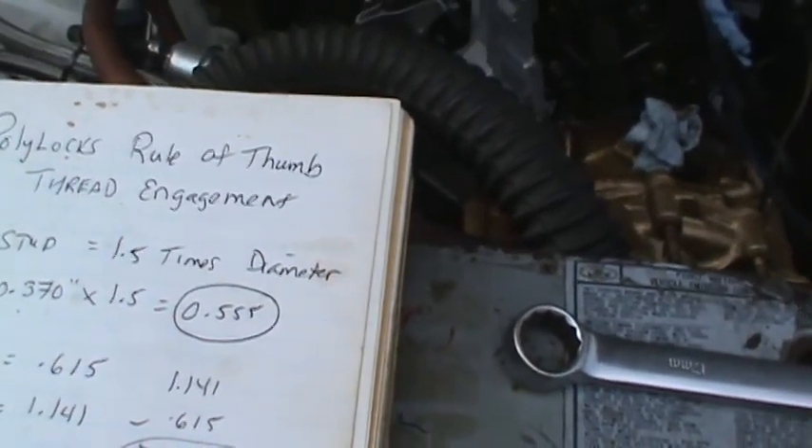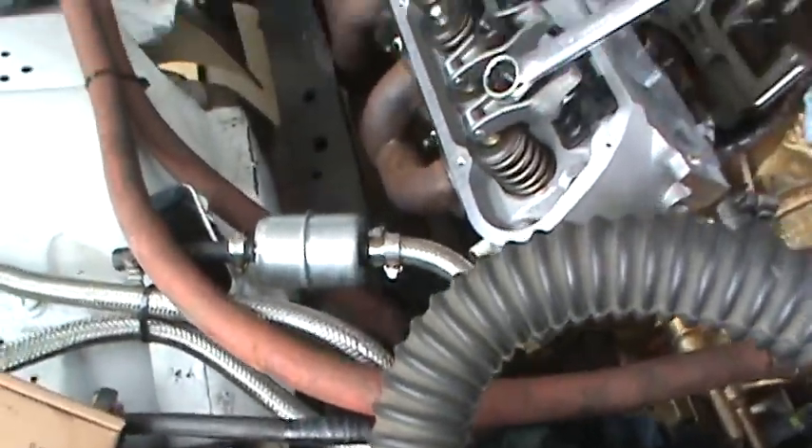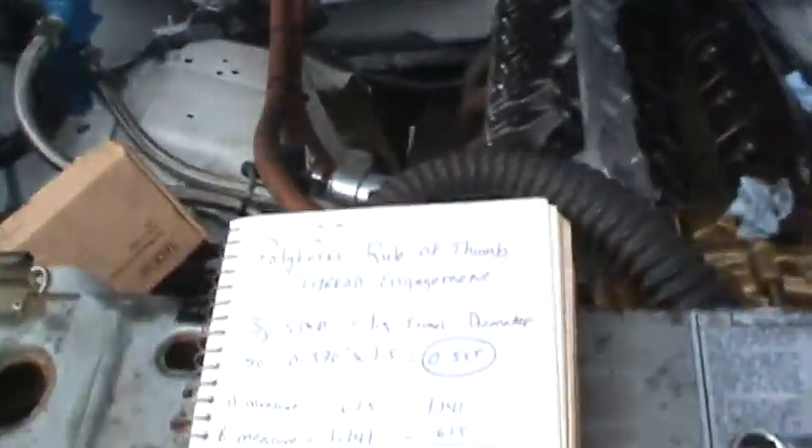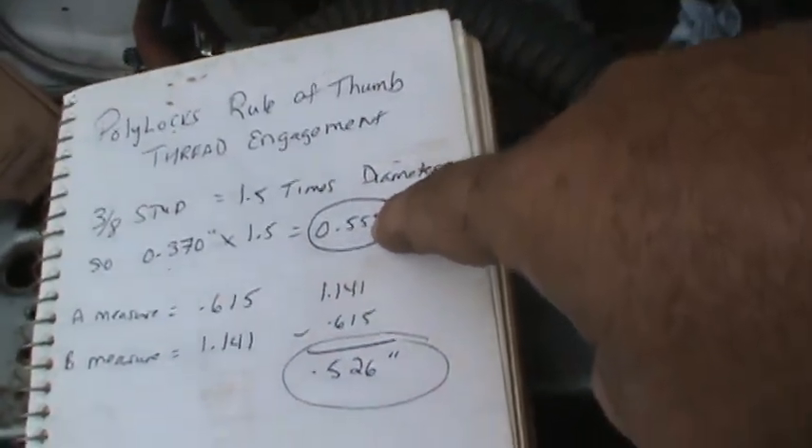It's not quite 0.555, but the thing you've got to keep in mind is I've only got a quarter turn of free adjustment on this poly lock right now. When I set hydraulic valve lash on small block Fords I usually go between a half and three quarters turn, so cranking it down another quarter is going to get me awfully close if not right on that number. So I'm good on these.